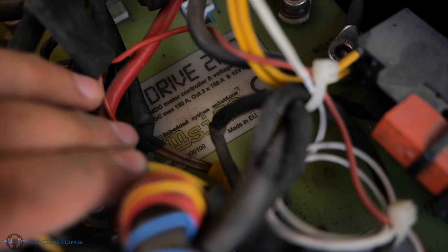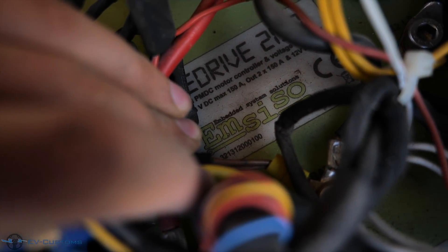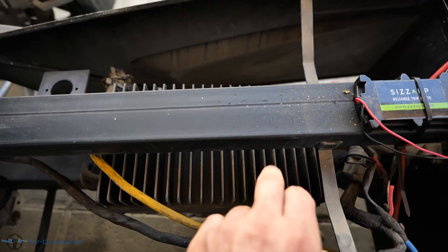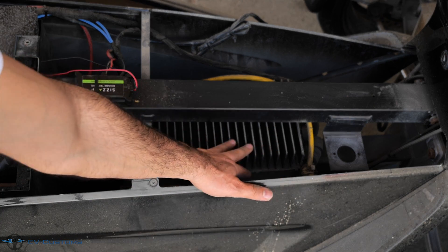About the controller, as I said before it is a dual motor controller at 150A 48V max output for each hub motor. The charger is built in and it is quite large with a huge heatsink. The characteristics are 48V 25A which is estimated at 1200W output. So for a full charge from 10 to 100% it will need around 6 hours.